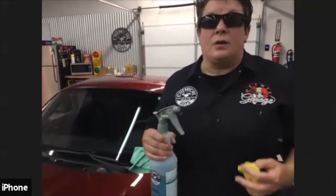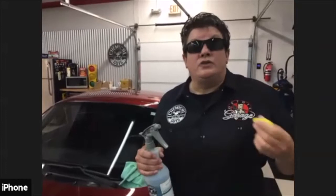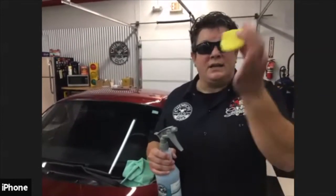A lot of questions I get: I'm just going to clay as I wash the car. Well, first, that's the big no-no, because if you're claying as you're washing, the car's not clean. You're going to clay dirt on top of the surface, and you're going to create scratches. And B, soap deteriorates your clay.